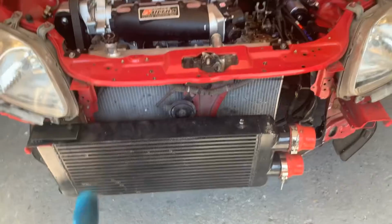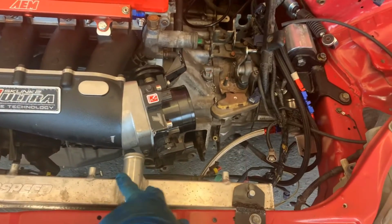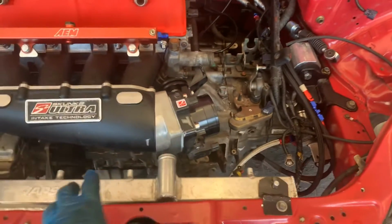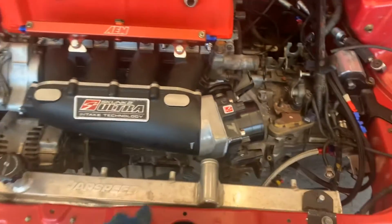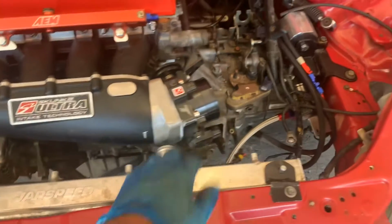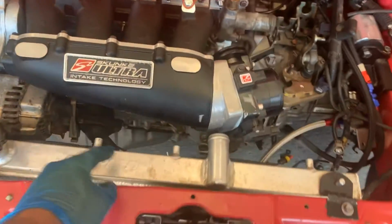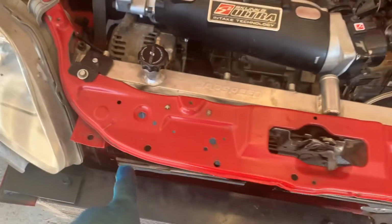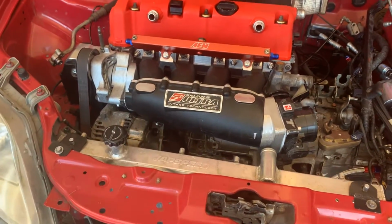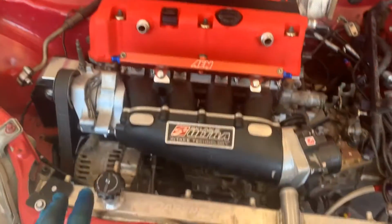Once I've taken all this front end off, first of all, I'm going to mark up the radiator on where I want this hose to be put. My mate Craig's going to do it. So I'm going to just put a little kink where I want that, get that marked up, get that taken out today, get that ready. I've ordered a little piece of alley to weld over the hole on the radiator to sort it out, and then weld that one in there. And I've ordered some alley rod, like this sort of size, to go on the bottom so it can peg better in the traction bar, because they are long enough to go in, but they're not long enough for me to be happy. So I'm going to put a couple, probably 3 or 4 mil, on each one of them, so that sits in nicely. So that's going to come out.